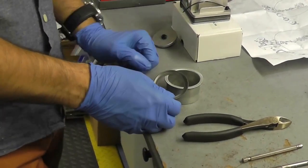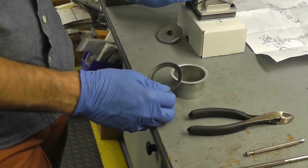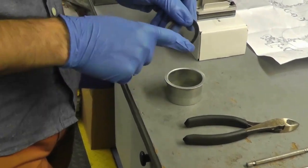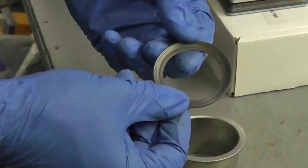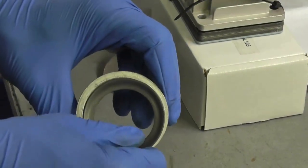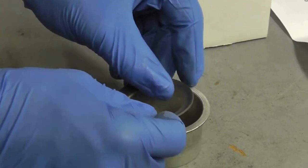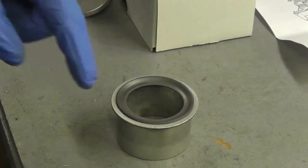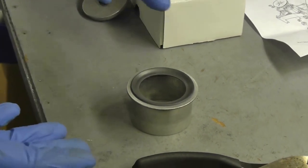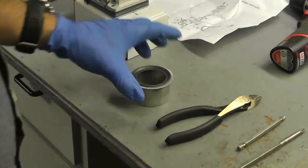If you have low compression, a lot of times it's because of the older single-style valve plate being defective. Also look at your piston ring — if it's torn, cracked, dry-rotted, or nicked around the outer edge and doesn't provide a good seal within the cylinder wall, you won't get much compression. We recommend replacing these parts together with the valve plate so it's like having a brand new compressor.